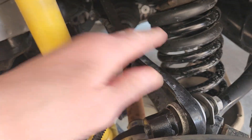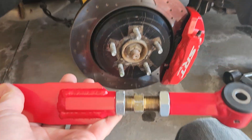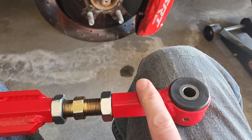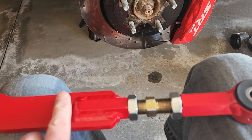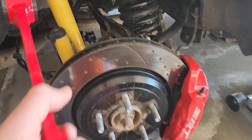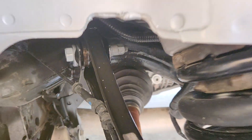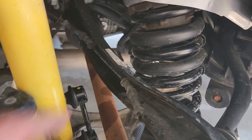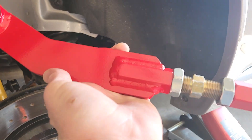I did the driver's side yesterday, so I gotta yank this guy out and install this one. It's double adjustable — you can turn this side to make it longer, and you can also turn this side to make it longer. It's pretty straightforward: one bolt there and two bolts back there. Pretty simple. You just gotta take off this line, and they provide a couple zip ties to tie the line back onto this when you're done.